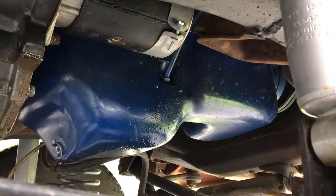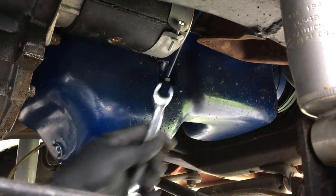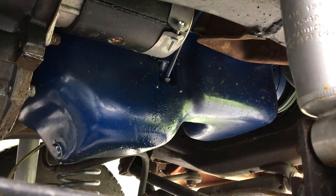Under the 1974 Ford Bronco 302 - I did put a 2.5-inch lift kit on this, which gives you more accessibility crawling underneath it. The drain plug is a 3/4 inch, and the flare nut on the dipstick is 5/8. So I'm going to go ahead and drain the oil.